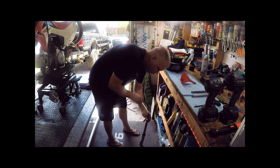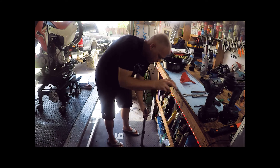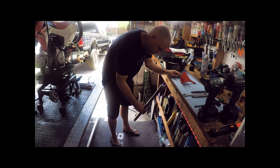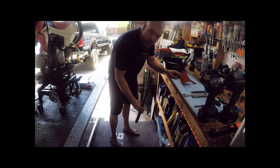Snug the cap up — once it's back in the triple clamps you can torque it properly, but I usually don't go crazy with torque on these; snug is good enough. And there you go — that's a quick and easy way to swap out your damping rods. As you can see, there wasn't much editing in this video because it genuinely only took about five minutes. Hopefully a happy customer, the bike's going to ride better — good luck when you do yours, see you on the next one.